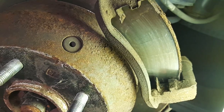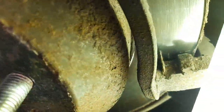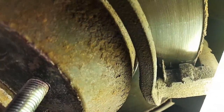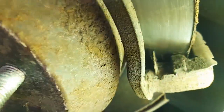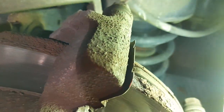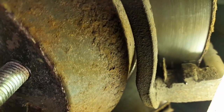The back brake pad spring is much smaller than the front one so you can't make a mistake. A lot of people put gooey stuff on the springs but I don't like that — the sand gets in and they get stuck. I like it dry, maybe silicone spray. That back one is very hard to get out because once that gooey stuff with sand goes in it's stuck and doesn't go back and forth.